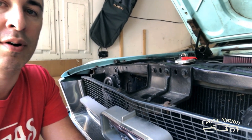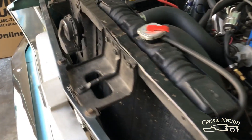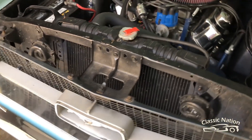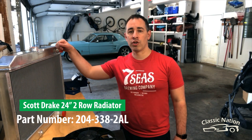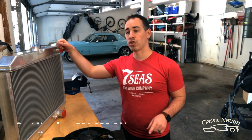I've seen the temperature gauge creep up, so I've got a couple of things in store. We're swapping out the stock radiator — this is the old copper two-core radiator that has seen better days. I'm putting in a 24-inch aluminum radiator, two-core with one-inch cooling tubes, so it's a huge improvement over the factory 20-inch.